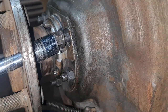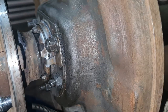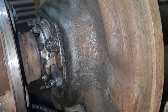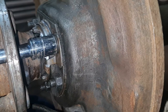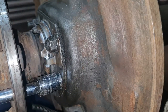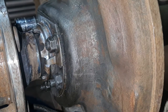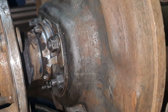So, job. And if you want the torque settings, it is 35 foot-pounds of torque on these, all right? So I'm just tightening these down correctly. I knew it wasn't a lot because they weren't overly tight. So right, do that one. Lovely. And there you go. Lovely. That's brilliant. Sorted, George. And that, guys, is how you do an inner seal on a Mopar 8 3/4 rear axle.